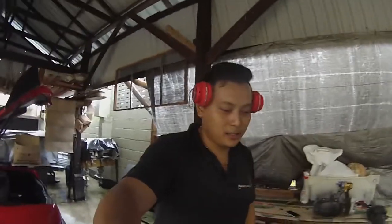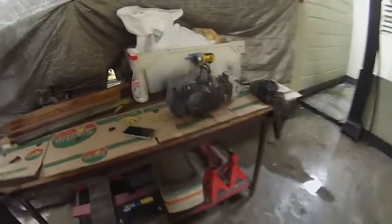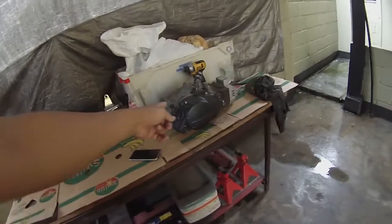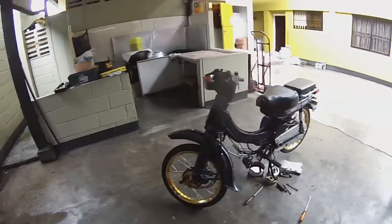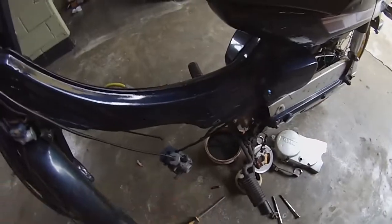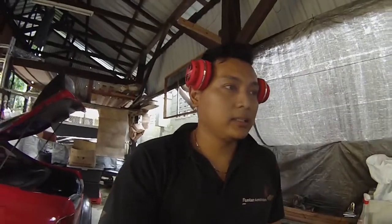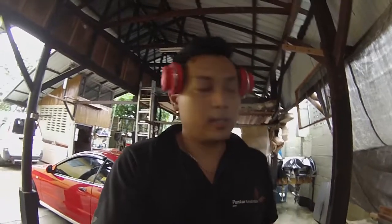Welcome to YouTube. I'm back again. As you know from the previous video, I was talking about the moped and how it got a second grinding gear, and I was gonna inspect it. Right now I have removed the engine — already removed the engine, didn't open it yet. I'm gonna show you guys what's inside and assess the damage. I have drained the oil. I'm thinking of two or three things it can be: the gear selector, the gear fork, or maybe the gear itself. I'm gonna tear into it and take you guys along for the ride.